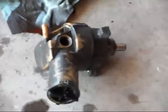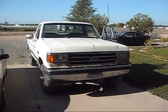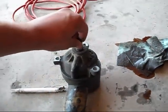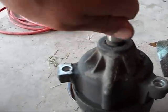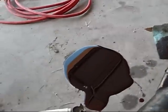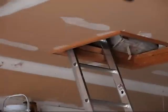That's the power steering pump. Anyway, that's the original power steering pump out of the pickup, and that power steering pump — the shaft on it is just no good. I mean, they're supposed to have some play in them, but on top of that the shaft is real hard to move, like that bearing inside is just trashed or something. And my power steering fluid is spilling — bleeding everywhere. But conveniently I had one in my garage attic.